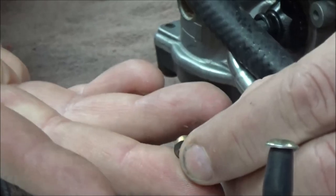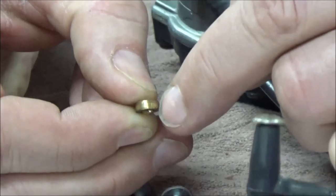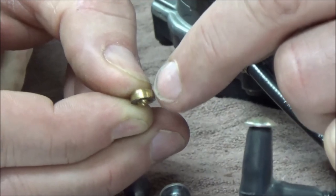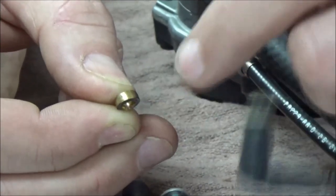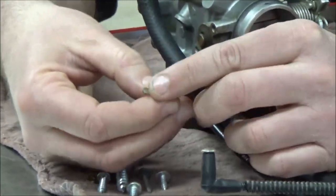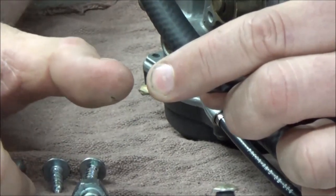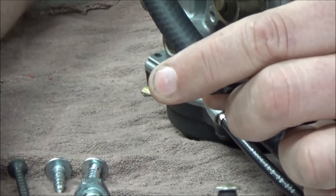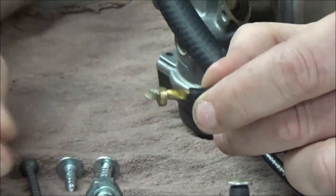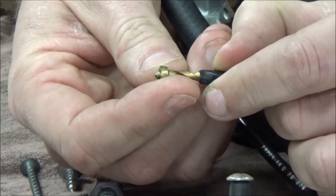Most all welch plugs are about the same thickness as far as how much we have to drill through. The problem with drilling the welch plug is that right underneath here is that screw, and when you take a pointed bit and drill into the head of a flat blade screw, there's a chance you'll take so much of the flat away that you can't get the screw out. So that's problem number one — we have to understand the risk. Right below this plug is going to be that screw, and it's a very, very short distance.